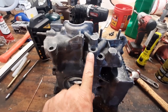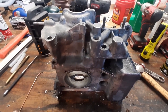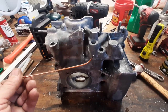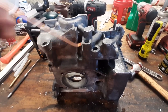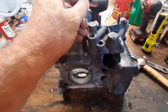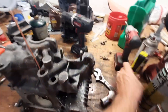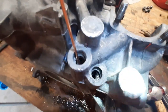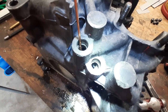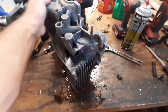The way I'm getting that piston out of there is this hole here goes down and across right to the top of the piston. So I took a piece of welding rod — it's pretty flexible, the end was already nice and round from where I had welded last time. Put a little angle on it, got it in there, got it around the corner, and then was tapping this with a hammer. As you can see down in that hole, it's pushing the piston back no problem.